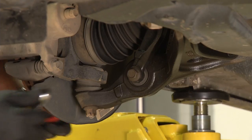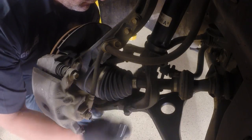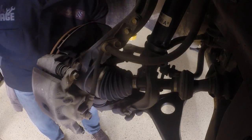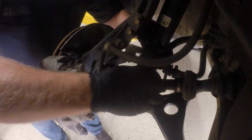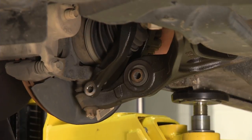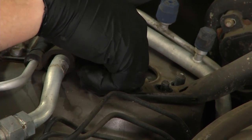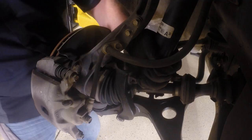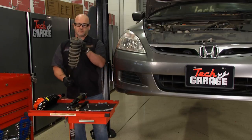Pretty simple to do — right tool for the job. We're going to back this lower bolt out. You may have to give it a little bit of encouragement — that's why I have a hammer here. We're going to move this bracket down and away. This is where the strut cartridge is now hanging on its own. Get a good grip — it's not terribly heavy on this car. Release the nut, and watch the brake hose as you come down and out. And there is the old worn strut with the factory spring on it.